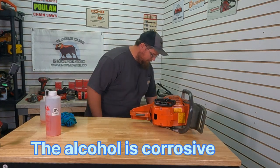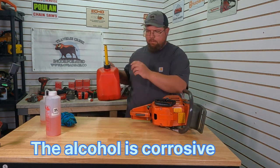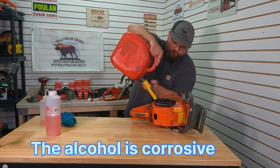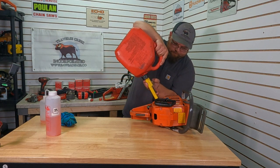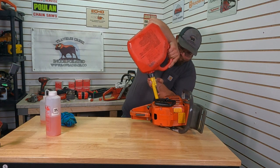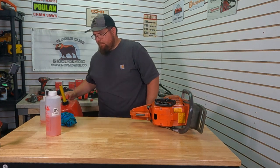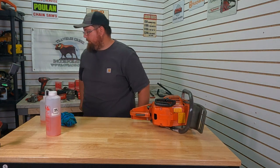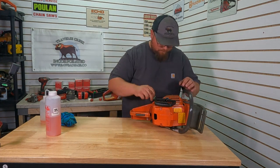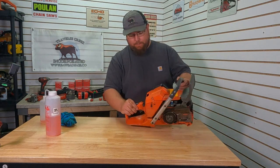All right, got our expensive fuel drained out. Now we'll flush it with some regular gasoline. This is just our 40 to 1 mix. Not changing the tune at all. Let me get my trash can here so I don't oil the floor. But we're not changing the tune at all, and you should hear it go super rich.